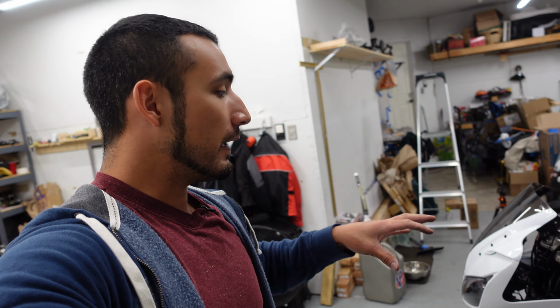Now, that being said, guys, I wanna make this build a two-part series as far as performance. So the first part is I just slap the turbo stuff on there and make it run, basically. Take it to the dyno and run it at, let's say, 10 PSI. Get a reading, make sure it's correct, of course, and then we bring it back. We break down the engine, we put in rods, pistons, port the head, and degree the cams, and run it again at the dyno at 10 PSI to see the difference.